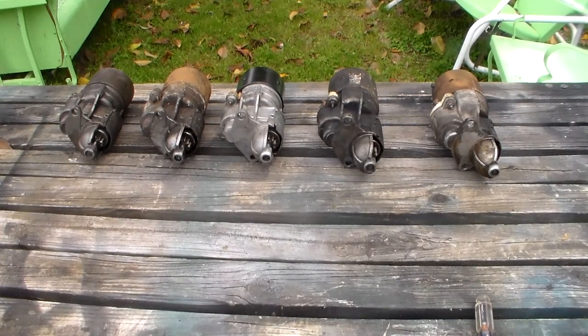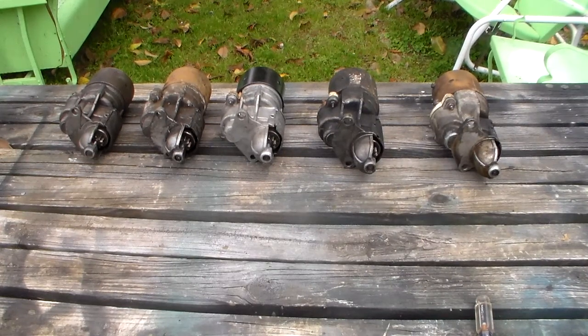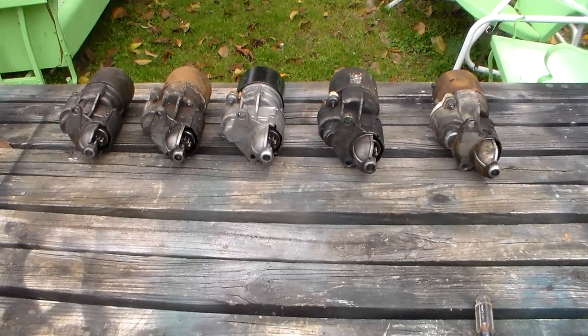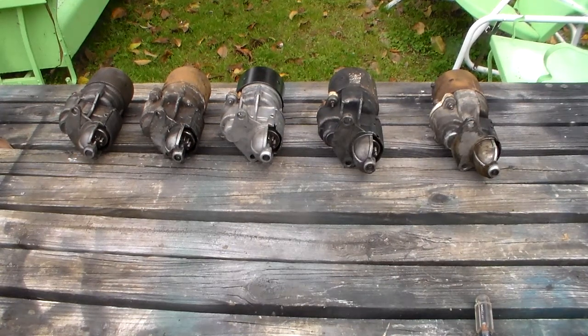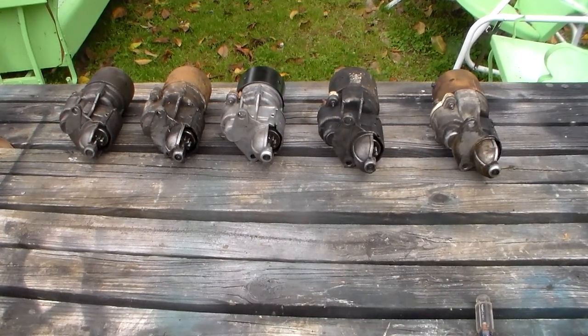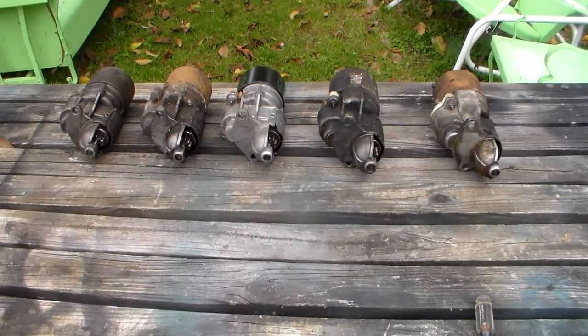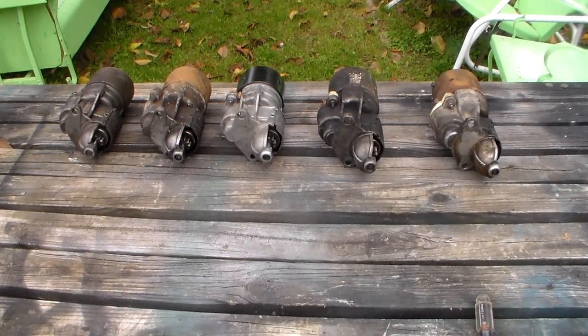If you want to hear an example, there's a video on this channel called, I think, Vintage Chrysler Starter Workout or something like that. I had a car one time, a 71 Plymouth with a 318 in it, and it had not the correct starter for that application. I'm getting ahead of myself, but it had a 2095150 starter, that same basic starter, and it just flung that engine over like it was nothing. But that was a non-rebuilt, well-lubricated starter, so it spun just fine, and it always did.